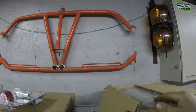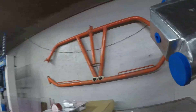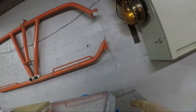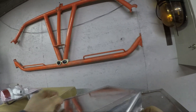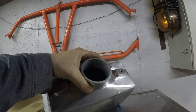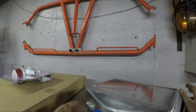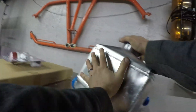This right here is our intercooler — they call it a Type 14. This is their 90-degree bend water-to-air. We've got inlet, outlet, and mounting points here. Look at the core in there — I believe this is three-inch in and out. This was part of their 600-horsepower kit, what this is supposed to be able to cool. It's not going to take up a lot of space at all.